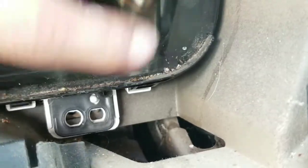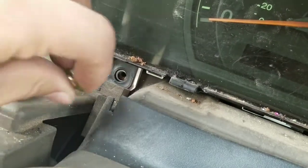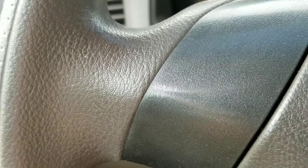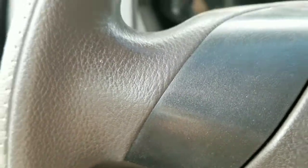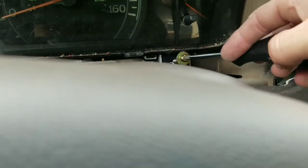See that black prong right there? It lines you up. The top should line up to that screw hole right here. Then you get your gold screws — try to put them in by hand first, at least guide them in there, because if you drop them you have to take everything apart to get your screw back. What you can do is get a magnet and rub it on your Phillips screwdriver so that it does not fall in, because it is magnetic.